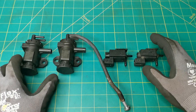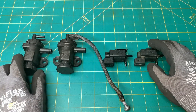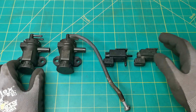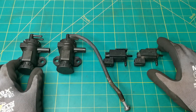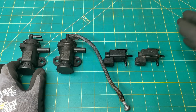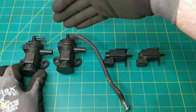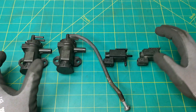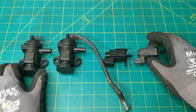The vehicle I'm working on is a BMW. It's got charge pressure related fault codes, drivetrain warning under acceleration, and is down on power. When you go on the low end and accelerate there are fault codes coming on related to charge pressure, which is related to the turbo, and any of these components here can cause that fault.